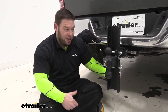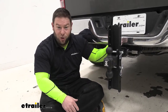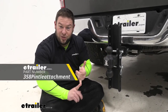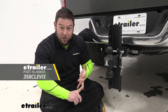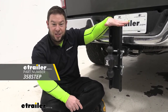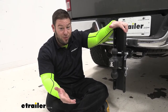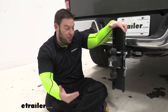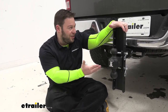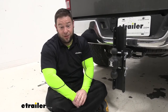There's a bunch of different accessories on here. So if you get a different kind of trailer or different equipment, you don't have to worry about buying a different ball mount. You just pull these pins out and replace this portion with a pintle hook, a clevis pin, or even shackles. You can even add a step up top that you can step onto to get into your vehicle. There's plenty of options because this ball mount is going to be with you a long time, and you can upgrade and customize it.